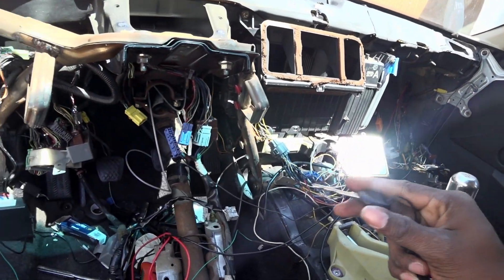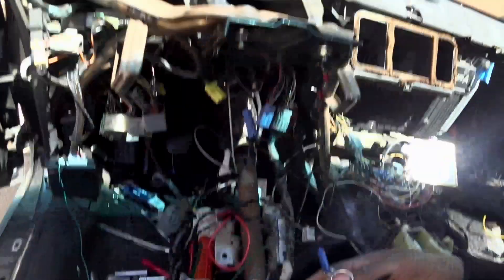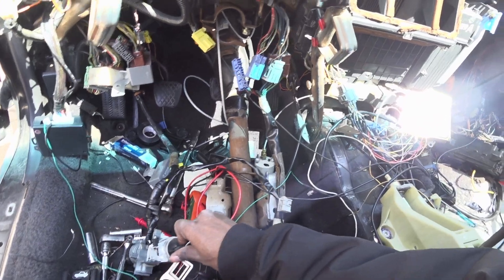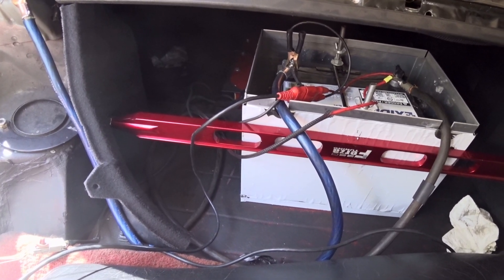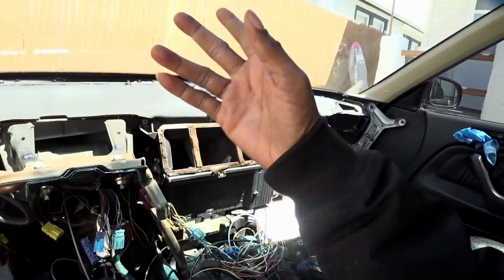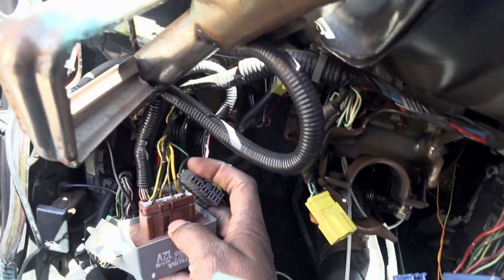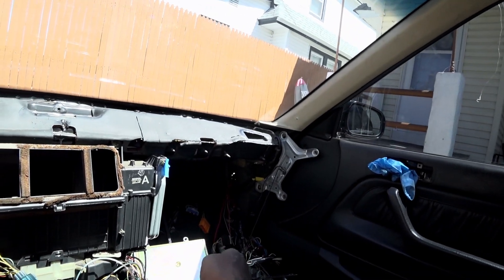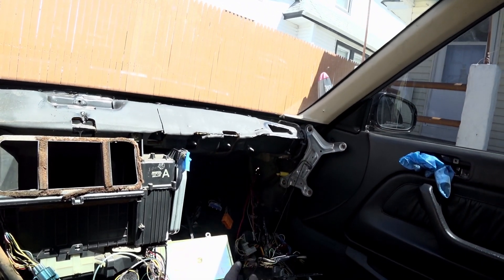I'm going to take the clutch pedal back out and examine whether those little clips are still in place or fell out. After all my digging, I found it — all my wiring is correct, which is a good sign. I even put in the old ignition switch. The fuel pump is coming on. This whole time it was the ECU — I back-traced all the wires and one pin, I think pin 7, is sending power and triggering everything for the ECU to work.